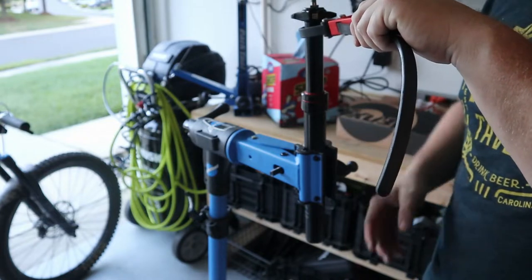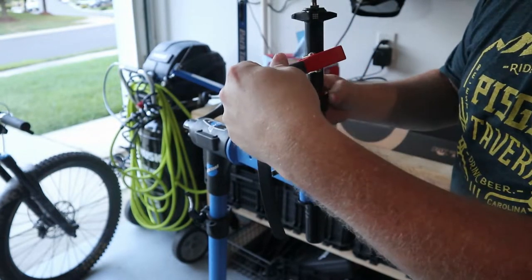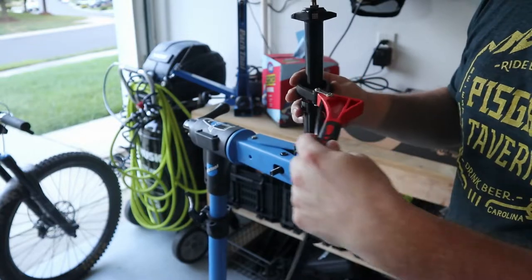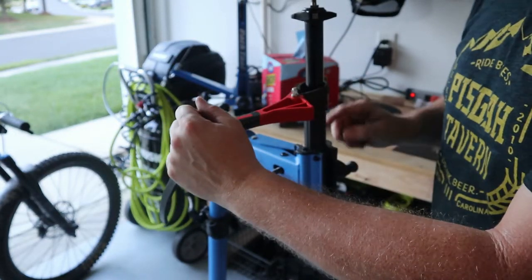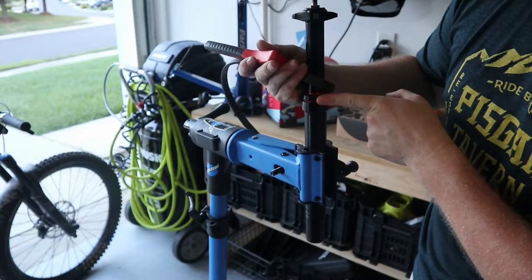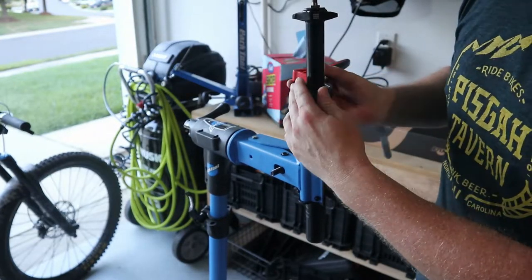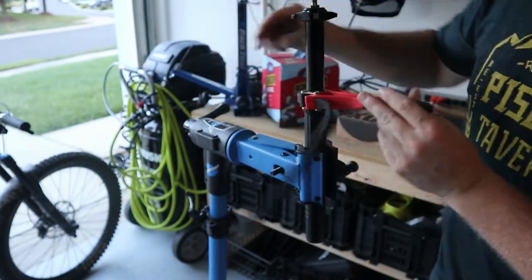I had to do it opposite. What I did is I put the case in and used a strap tool to put it around the nut, and then removed the nut versus spinning the bottom. There are always multiple ways to do things, but my stand at the top — you have to get it around only this piece here, and my stand is too flexible at the top and it wouldn't clamp. So I put the strap wrench on it and the collar nut spins right off.